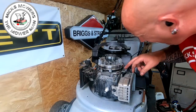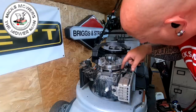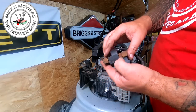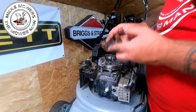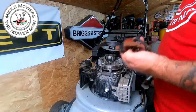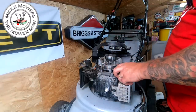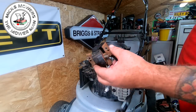So your coil is off. I'm just going to double check this coil wire, making sure that's not got any cracks in it. If that coil wire is a bit crimped up, that could be a problem too. But this coil itself — look at the state of it — it's absolutely rusted to buggery. However, there are good terminal points here, though they're not very clean. So I'm going to risk it for a biscuit — I'm going to try and clean this coil up. Is it broken because it's rusty, or is it just that the coil is actually duff? I'm going to hit this with a wire wheel and give it a good cleanup.